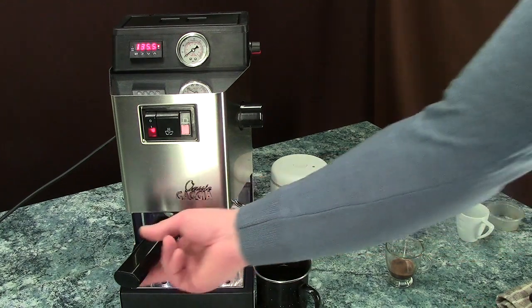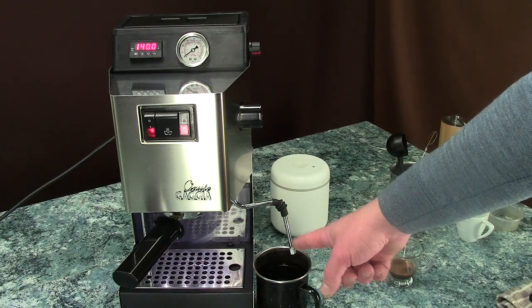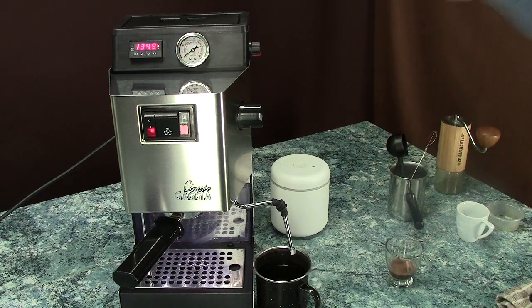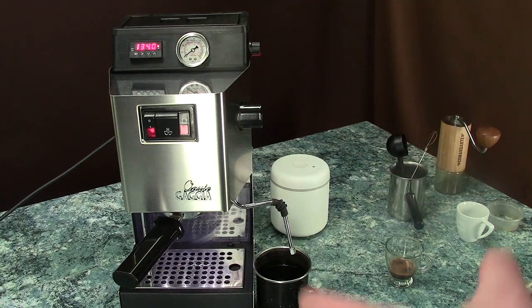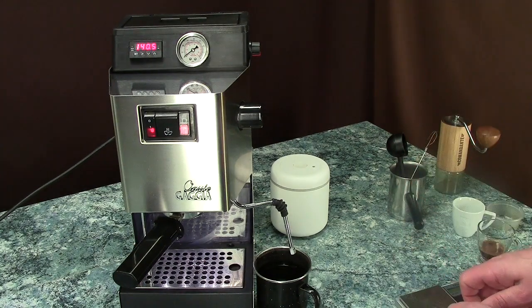But to get over that, you should have a blank filter basket, so we're only going to have any output through the steam one. And the dimmer set to a minimum setting, so it can really slowly introduce water to the boiler. Kind of, it keeps replenishing it, and it also adds a really minimal pressure to the boiler.